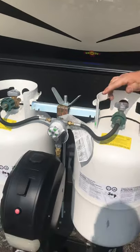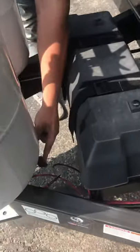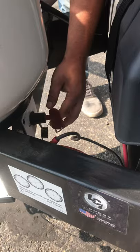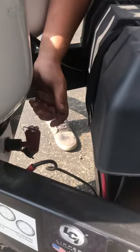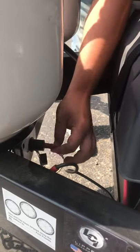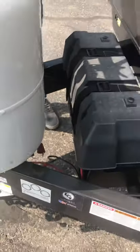Next we have your batteries — two batteries in here. There's also a battery disconnect switch underneath the tanks. You want to make sure this is turned off if the unit is not in use and not plugged in, to keep it from draining dead on you. It does charge off your vehicle while you tow, and it charges off the cord, so if you're towing it, using it, or plugged in, make sure the disconnect is turned on.